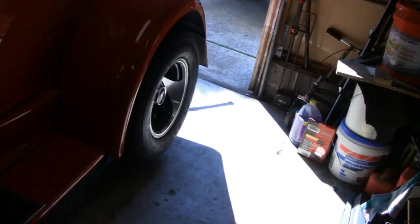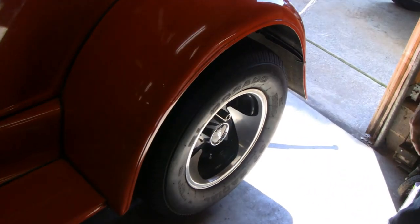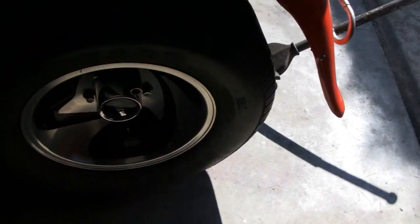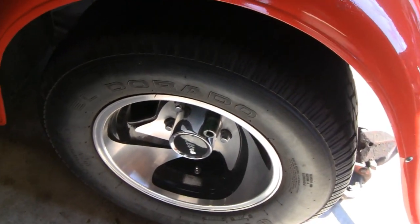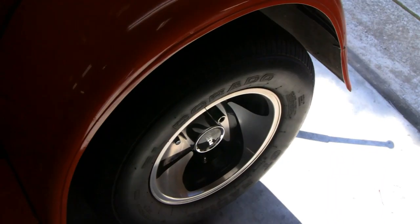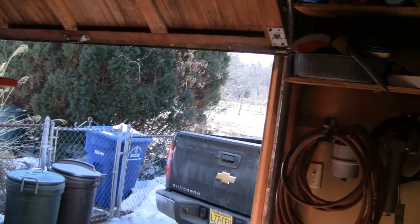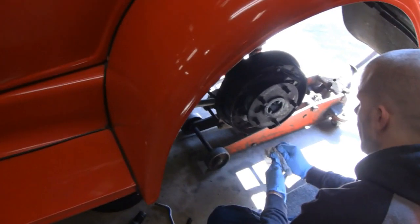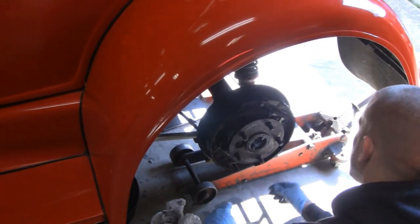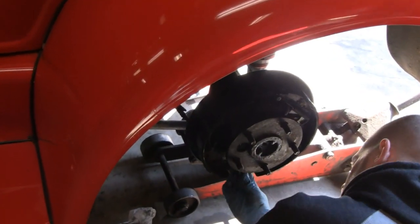We've got a leaky wheel cylinder in this one, so we're gonna have to take the wheel off — might as well change both of them while we've got it off. Problem with these cars is when they throw them together without a build sheet, you don't know what you're dealing with. We know we have a Dana 44 rear in this but we don't know what the wheel cylinder is. Hopefully there's a part number on there. It's a nice day out — our first 53-degree day all winter. Little racer got the drum off. You could use a set of brakes — this one's pretty thin. Back one's not too bad, and the adjuster is pretty much adjusted all the way out.